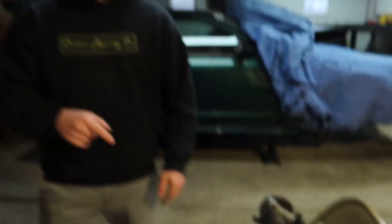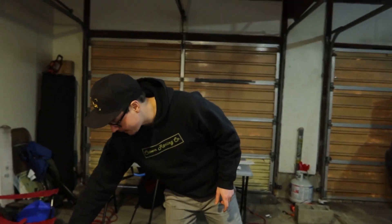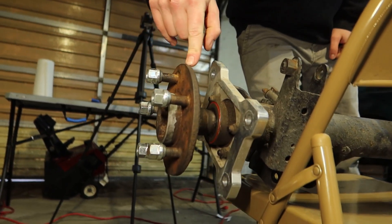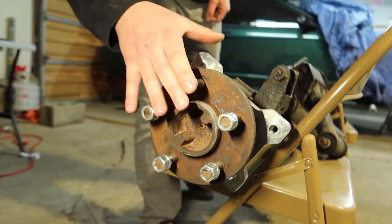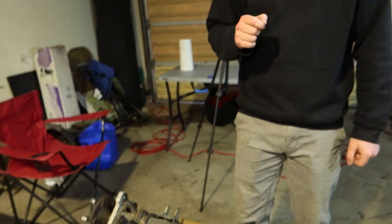While we're in the middle of reinforcing the strut towers, I made some modifications to my rear axle. These are the stock axles, but I upgraded to some hardened axles. They're still 28 spline because I didn't feel like upgrading to 31 spline — doing the diff and everything wasn't necessary because this is a drift car and the biggest tire that goes on it is like a 255. So I ended up doing 28 spline but got heat-treated hardened axles.